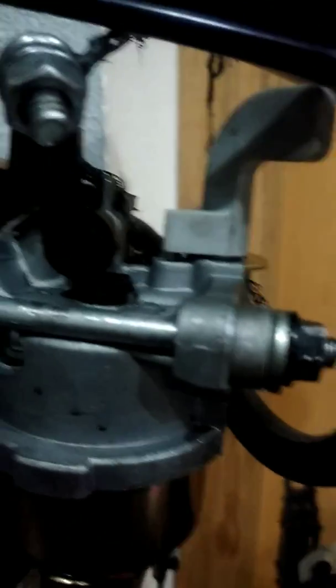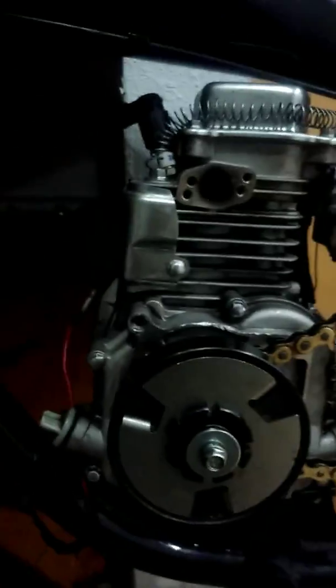This is the spring I use for my throttle. Somebody was wondering about the bypass — basically all it does is go directly up there and ensure it stays in place. That's the governor pin and the arm that used to connect to all the stuff that would move whenever you pressed the gas past a certain level. I still have my governor — you can see that pin right there is the governor's pulley. That trick was phenomenal so far.